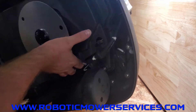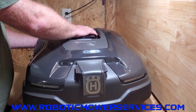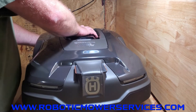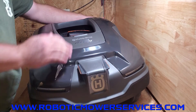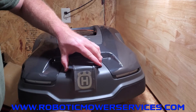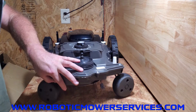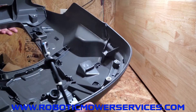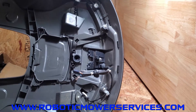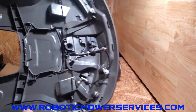With the wires free, hold down on the center part of the top cover. Being a 300 series, you have joysticks here, here, and here that just snap down over. Lift it up off those two, hold down and give it a good tug, then come to the front. You might have to reach in underneath because of the pivot — there's only one joystick there. These are rubber snap-lock caps that the joysticks latch into to hold the cover in place and allow it to float and activate those joysticks during a collision.